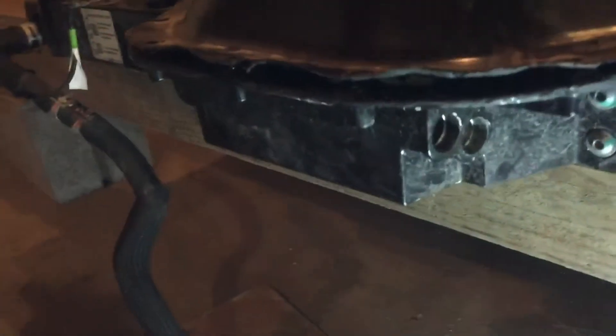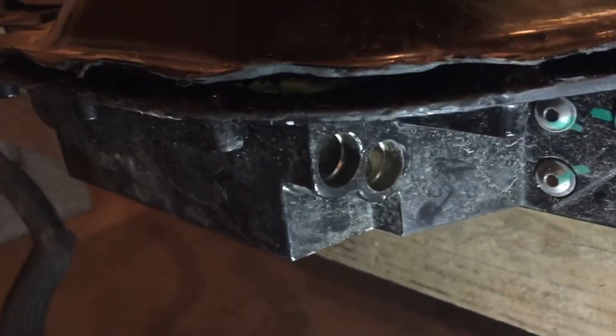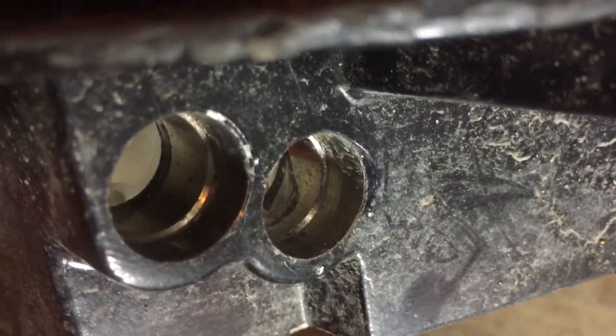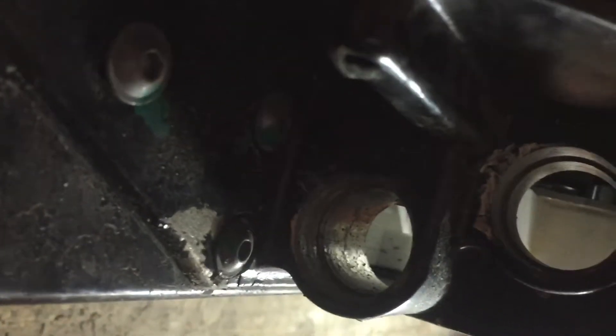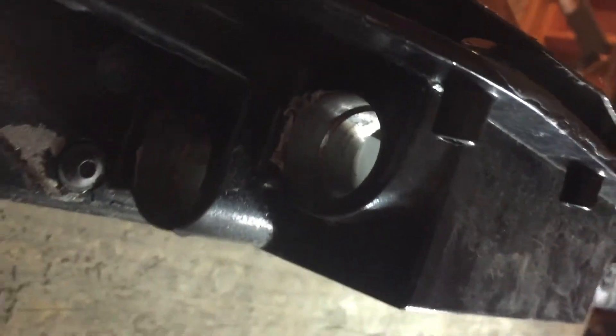I'm making this quick video to show you the connections at this junction box. On this side there are two small fittings — I measured them and they're actually tapered. I can't find this fitting; I don't really know what Tesla used, but it's about 5/8 of an inch, so my charger wires come out of here. On the other side, this one is about one inch, just maybe slightly more, and I ordered cable to come out of here and go to the car. I have two Anderson SBX 350 plugs that I'm going to connect to the car.